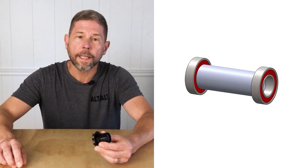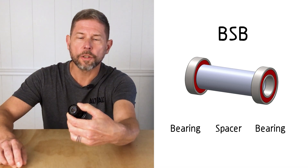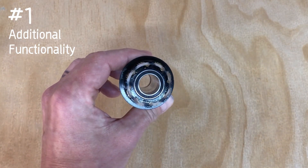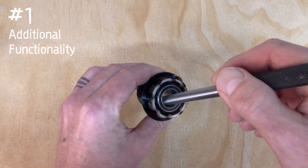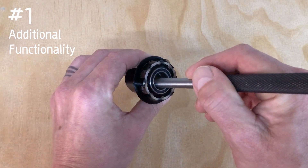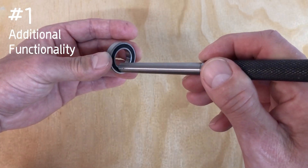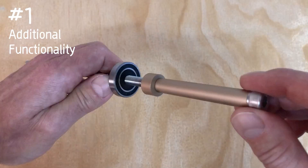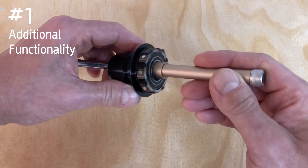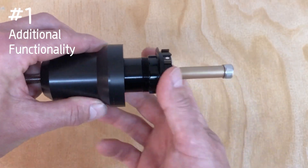Here is a hub designed with what I like to call a BSB configuration — that's when you have two bearings separated by an internal spacer. This is common in hubs, freehubs, and suspension. There isn't full access to the back side of the bearing, so often a manufacturer will design the internal spacer to be pushed off to the side so that you can access a bit of the bearing to use a punch and a hammer to remove it. I don't like using a punch and a hammer because it works with a striking motion, and if you get the bearing cockeyed you could damage the bearing seat. This is why I designed the Alt Drift — to press out that bearing in a controlled manner. It goes in, moves the spacer off to the side, presses against the back side of the bearing, and then with the leverage help of the bearing press, presses out the bearing.